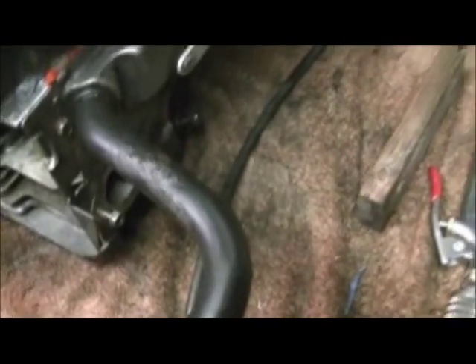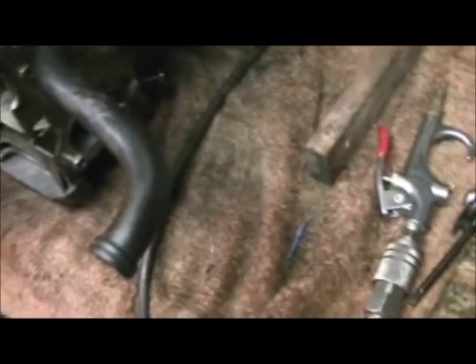I'm going to put some of the bottom coverings on first if I want to run them — these engines seem to run cooler without them, so most likely I can go without them. It turns over pretty good with no plugs in it right now. I'm going to finish torquing the heads when I get it into the tractor — it'll be a lot easier. The block's done. I got the little vacuum line right here — it goes to the left cylinder valve cover. With the other valve cover on, I used new sealant — the red high-temp gasket maker. Unfortunately it didn't really come with a cap, so I'm going to have to leave it like that. It should just dry up at the tip. There's still quite a bit left in there — wasn't horribly expensive, but I don't really want to waste it.